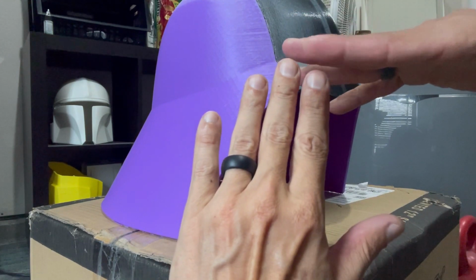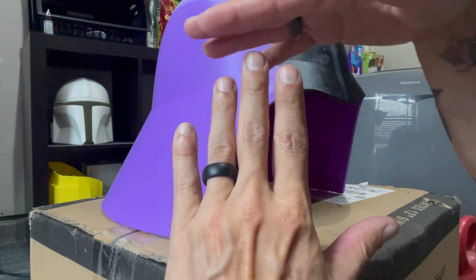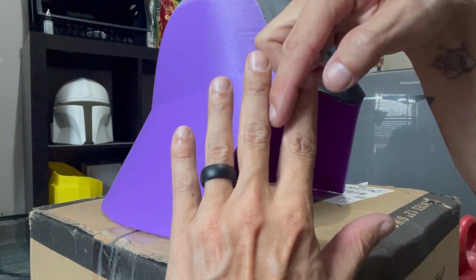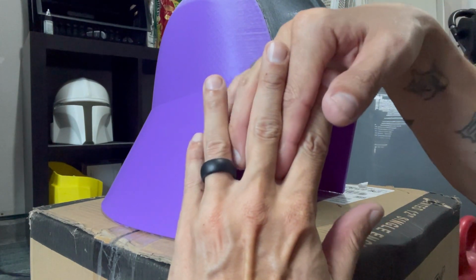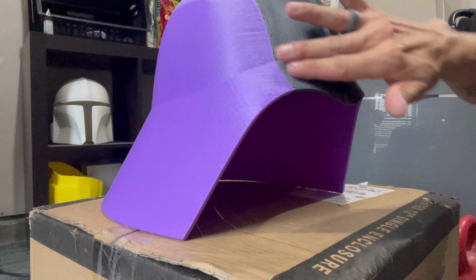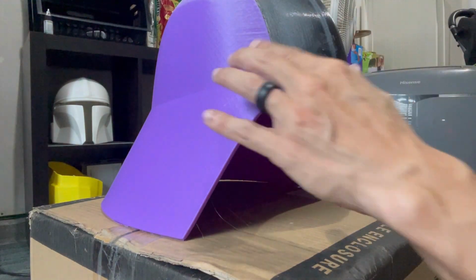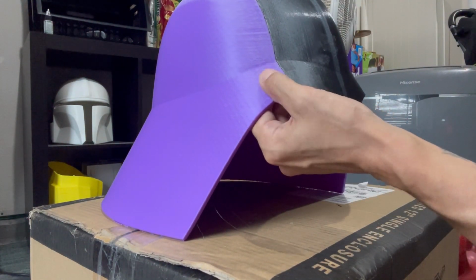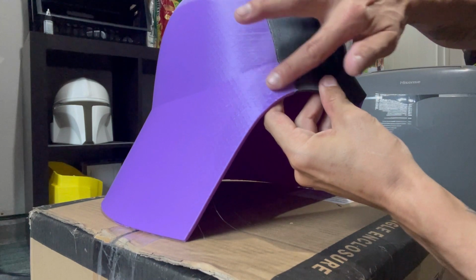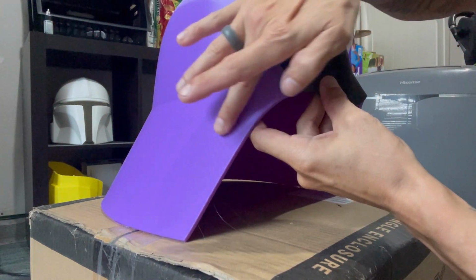So when you put that resin, that filler, whatever, on, not only does it sit on the surface, it goes in these little holes. It's almost like it's giving it roots so it can grab on. So that's very, very important. When you're doing work like this, you don't need it completely smooth. You want a little bit of grit there. And if you hear how this is actually rougher?